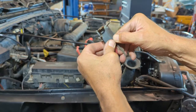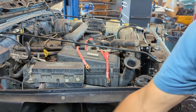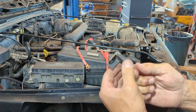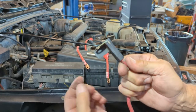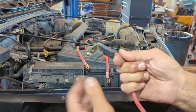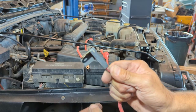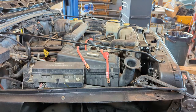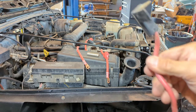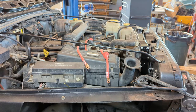So I just took it over to the workbench and I got it cut in half. So now this piece can go back down there. For you guys that are wondering how deep-seated corrosion can get, if you look here, you can clean a terminal and think that you're good, but you can see how it goes all the way down into here. I didn't even open up the rest of that wire yet. You can really see how corrosion will go in deep. And that is the whole reason for my change out. Just because you can see corrosion on the outside and clean it off doesn't mean you're getting the corrosion that's on the inside of those wires. So just something to consider.